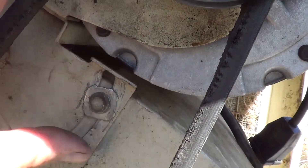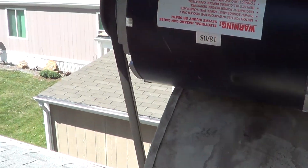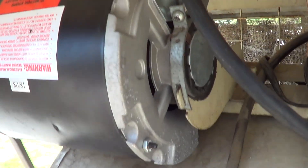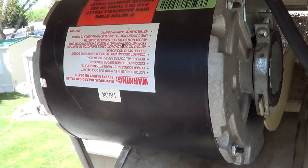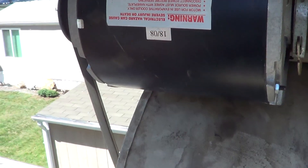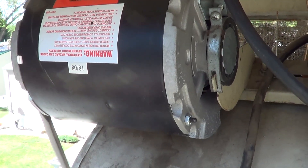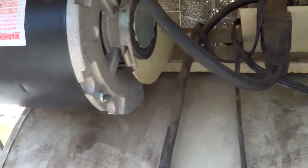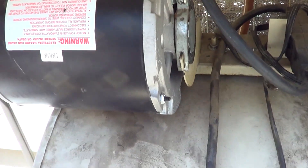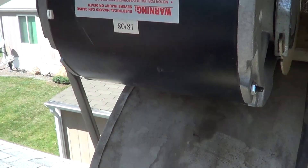Sometimes I'll put a little pry bar right here, lift the motor up, get the belt tight where I want it, then tighten the bracket back down. That nut loosens the bracket to go up and down and tension the belt. One more swamp cooler motor installed — really straightforward. Just follow the steps; it's almost like reverse engineering. Don't get intimidated by the wiring, make sure the power is off, and take pictures as you go to help keep track of the wiring.